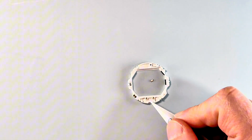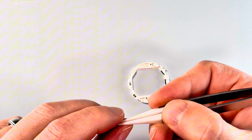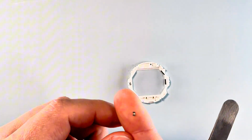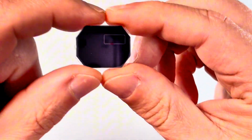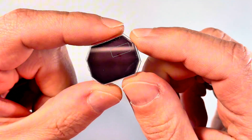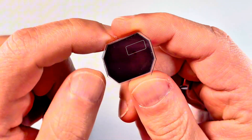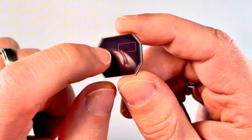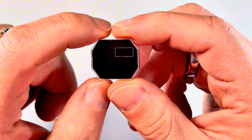You can either remove these including the two springs, but personally I don't see any point. I'm just going to replace this LED and then sit the new LCD in place. This particular one has to be facing in this direction — see how tiny it is. The new LCD, there's effectively a little red dot on it. It's much easier to see on a positive display, but it's negative so the red dot is quite difficult to see. The reason that red dot is there is because there is a thin removable clear layer that we remove right at the end. A lot of people don't realize these layers come off and they end up removing the dot with a bit of alcohol. This layer itself is removable and we'll leave that on right until the end.